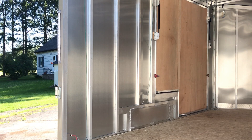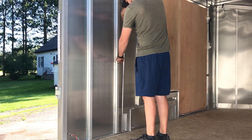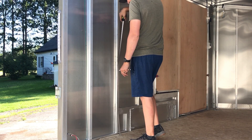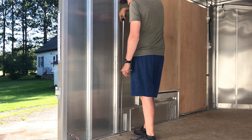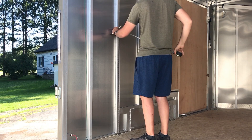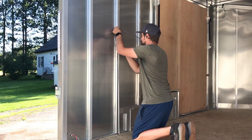Sadly, this is the last bit of video I have from the window install — and obviously this isn't even the install yet. Now that I have my measurements from the SketchUp model, I can go in my trailer and measure and mark it on the wall. I believe I then drilled some holes from the inside, and from the outside I could see the two holes that represented the bottom corners of the window. I then taped off the area and, using the window and the trim ring, I was able to trace the window opening onto the tape. Then I used my jigsaw to cut from one of the holes all the way along my trace line. It's much easier to cut from the outside in this circumstance, because otherwise you'd have to climb over a stud twice with the jigsaw. And then I ended up with a giant hole in the side of my trailer. At that point you can set the window in there — but this is where things got a little tricky for me.